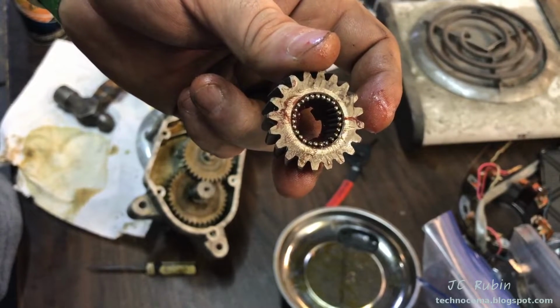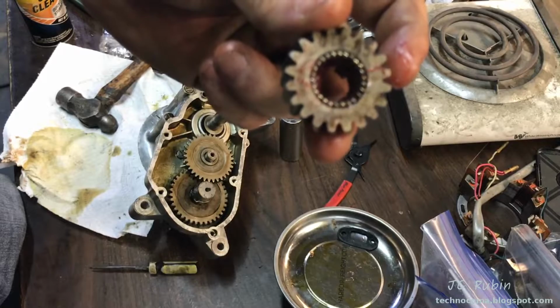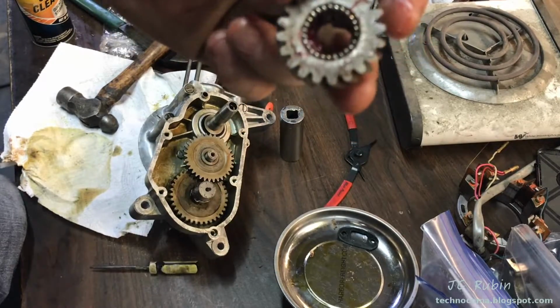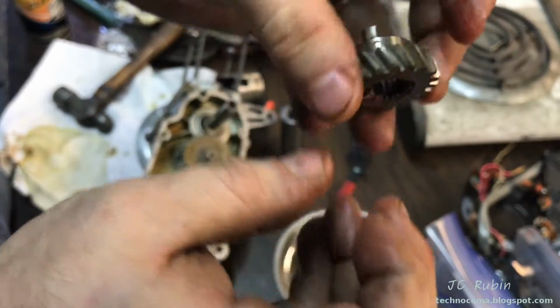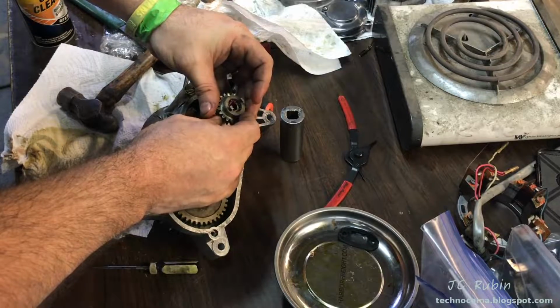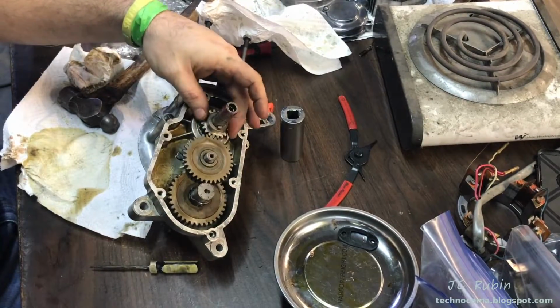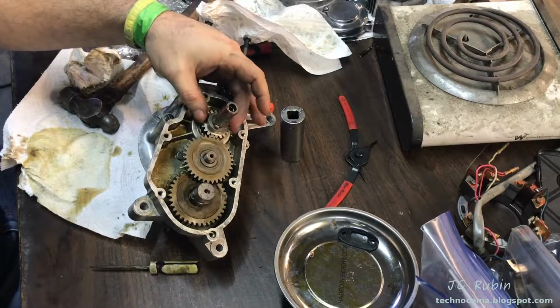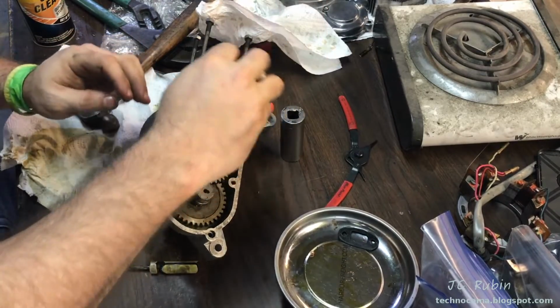I've got all the needles loaded, held in place by grease. I'll carefully try and get it over the shaft in position without moving any of them, I hope. I gently push them up towards the top where they seat. There is a flange up top to stop them from moving forward. Able to lower the bearing down, and everything fits just fine. Again, removing more of the excess grease.